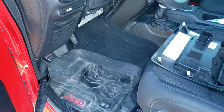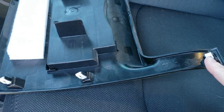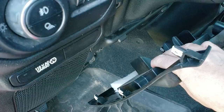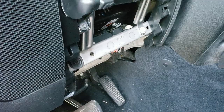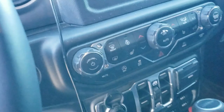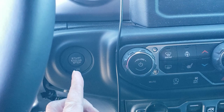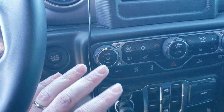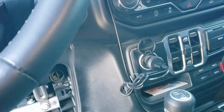In order to gain access, you've got this panel that goes right up in there — this thing just snaps right out. You have six of these plastic clips — three on each side of it. When that thing is up in there, you can just grab it and gently pull straight out. Don't try to put side load on it, just pull it straight back and it'll pop off. That'll give you access up underneath of your dash. And then what I'm going to do is pull out this trim bezel that has your push-to-start button and your radio controls. That whole thing will just pop right out, and that'll give us even more access because I'm trying to get to this area in here to mount the control switch.